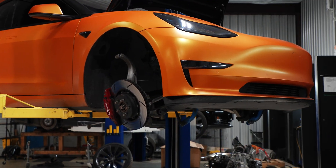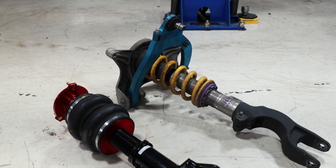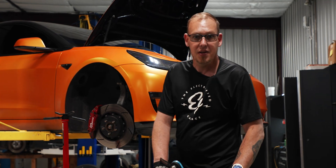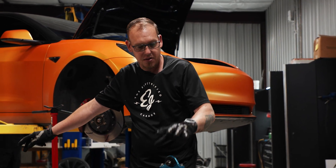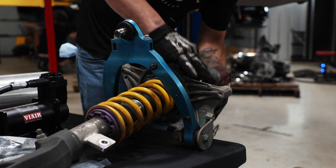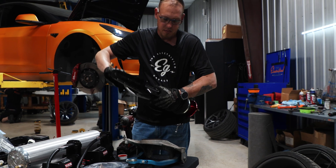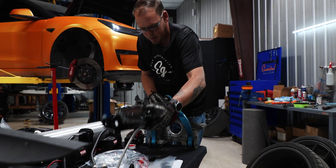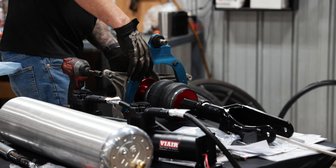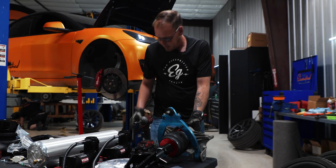Now we're going to swap the hat from this one to the new one. The only parts we're going to be reusing are the A-arm and the strut top. For your sway bar bracket, put it exactly as it was on the other one. Sometimes you might have to spin the top a little bit because they don't come perfect, but this seems to be a nice kit — easy install. Look at that, lined right up. Kudos to the kit.